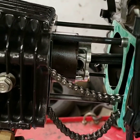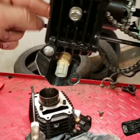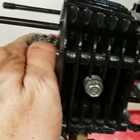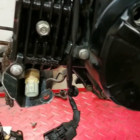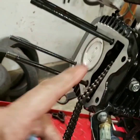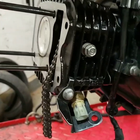I've compressed the rings and slid the cylinder on to the piston. I got the little roller — the one that's in lieu of the cam chain guide — placed where it needed to be. I had my cam chain kind of slip out of there while I was trying to get this on film, but I got it slipped on there into place. I've got a little bit of excess oil. I want to clean up this head gasket mating surface. We're making some headway — pretty excited about it.